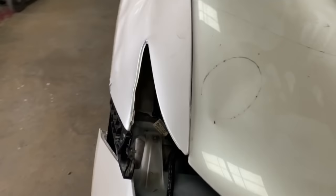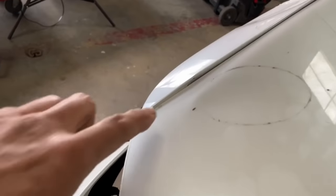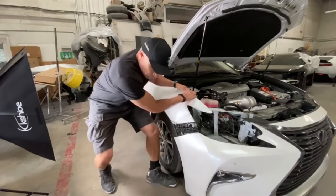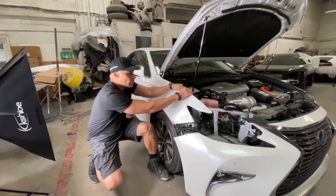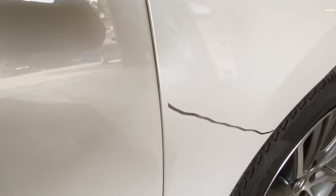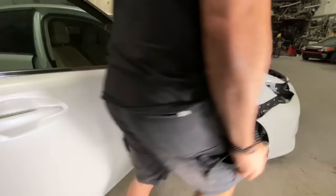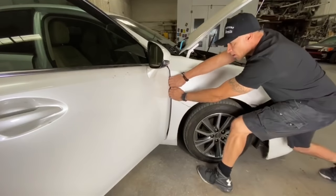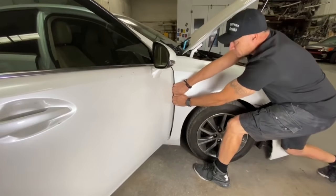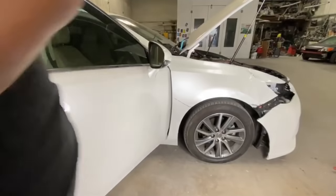When was the last time you saw a dent pull like this on YouTube? Hit the like and subscription button for my next PDR body repair. The man of steel is going to make a few more pulls with his hands of steel. There is additional damage on the back side — the bracket is pushed in. I will need to bring it out to get the proper gap and spacing for the door and the fender. Now opening the door so I can do another series of simple pulls on the fender edge. The gap is now looking better.